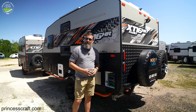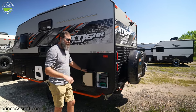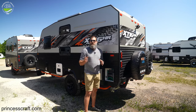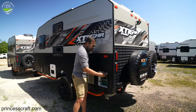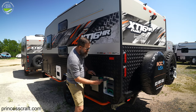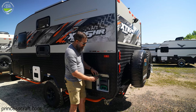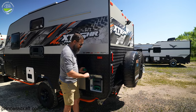Let's talk about how to prepare it for use. The first thing for prepping your Thetford cassette toilet is making sure that there's flushing water in the system. There are systems that use water from the fresh water tank, but this system has its own fill tank. You'll be able to see the level of that water in this clear sight tube. To fill it up, we rotate this out 90 degrees, take off the cap, and just add fresh water to the system right here.